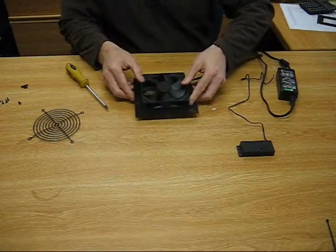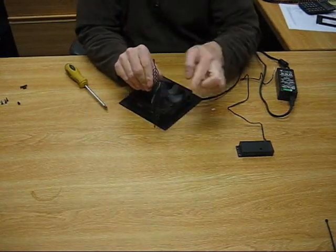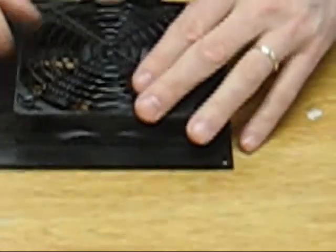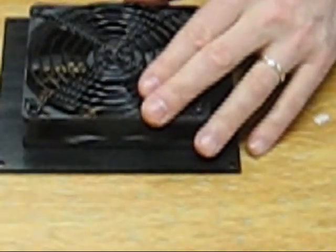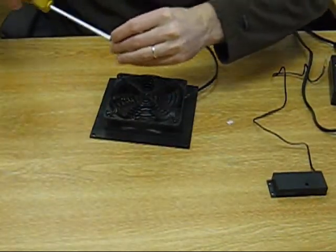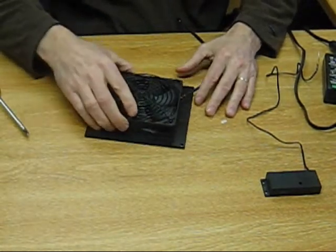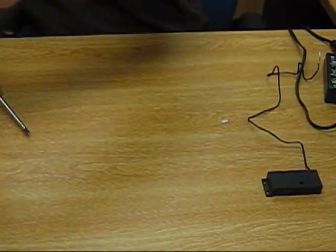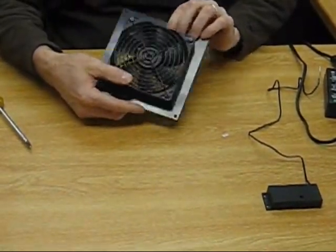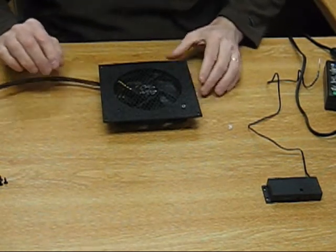All you need to do is put the protective grill on the back. This particular protective grill, we call it a finger grill, it's actually offset on one side, and you want to put the offset away from the fan. If you put it on the wrong way, it may bind the fan blades, and your fan will not turn, which is a problem. Okay, goes on like so. I'll show you, I've got a finished one over here. The protective grill on the back. It also comes with 4 wood screws that are used to attach it to the cabinet.